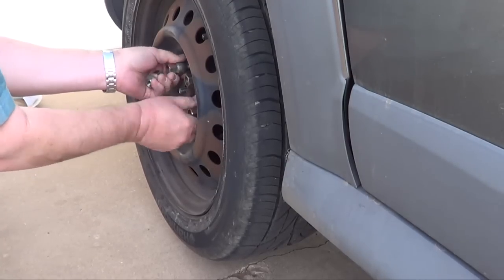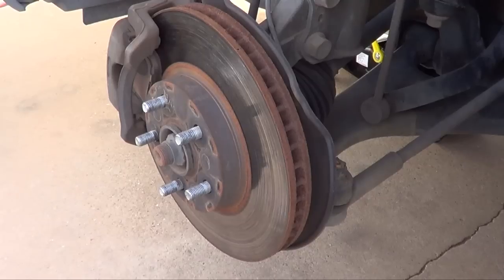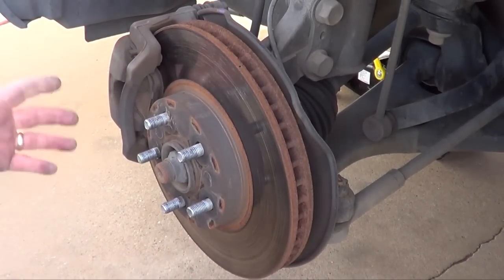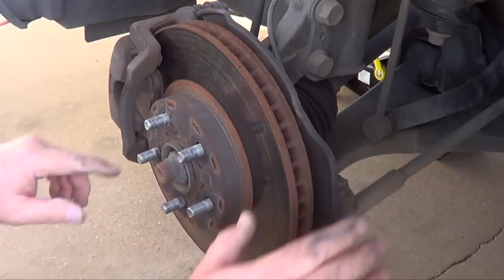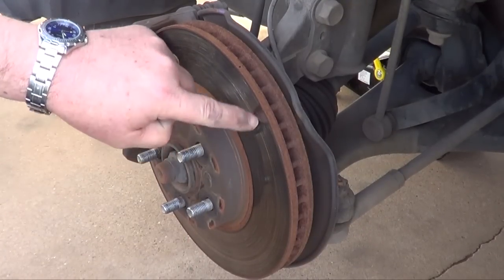Use all this at your own risk — I won't be responsible for anything that happens to your car. If you look right here, I'm feeling these rotors. I don't have any pedal flutter. The only thing is my brakes are just worn — it's been three and a half years since I changed them. So if you've got grooves and pits in here where you can't easily do that, you're going to have to buy new rotors.